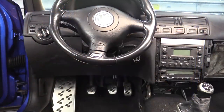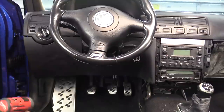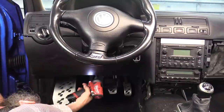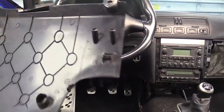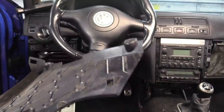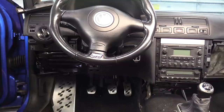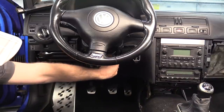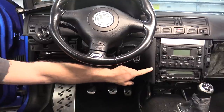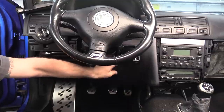Next up, we will do the lower driver side trim. Remove the side cover trim just like we did on the passenger side. You have three screws down at the bottom to remove. Pull the outer trim away — if your trim is in good condition it'll take a little bit of effort, but mine pretty much falls off because it's mostly broken. For the inner one closer to the radio, there should be another screw, but shockingly my trim is broken, so it doesn't have that screw. Pull this inner trim straight back because it clips into the bezel around the radio.